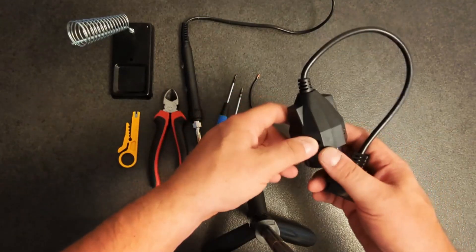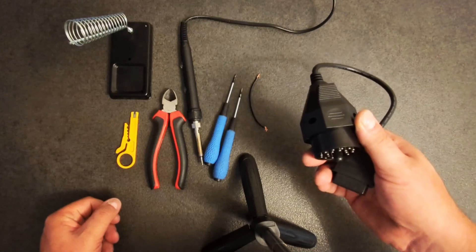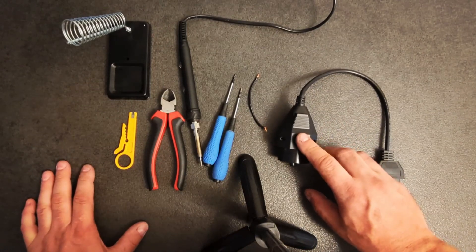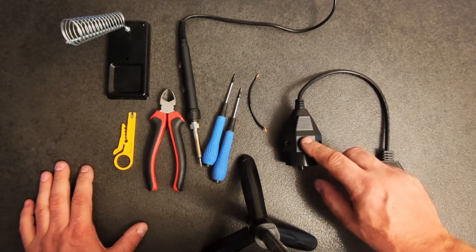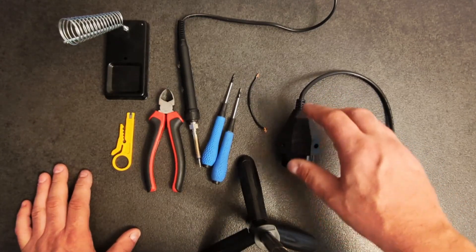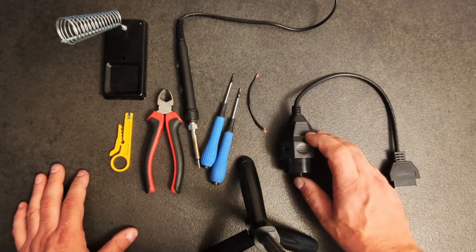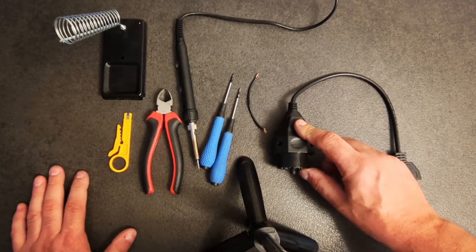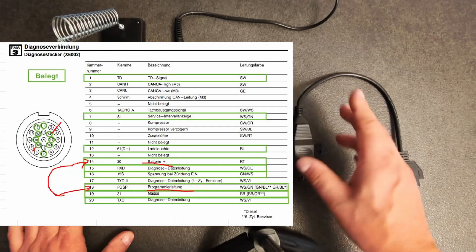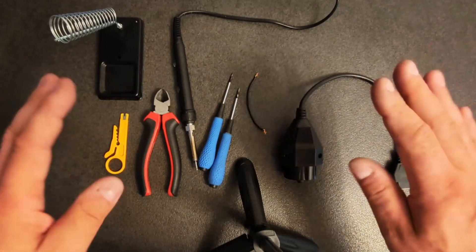The problem is that out of the box this adapter can only read data but not write to the ECU. On the MS41 ECUs, to be able to flash the tune you need to apply programming voltage to the ECU. This means two pins in the diagnostic connector have to be bridged — pin 14 and pin 18 — in order to apply the voltage and then flash your tune via MS41 Quick Flash or any other flashing software of your choice.